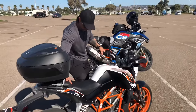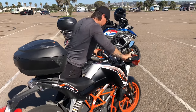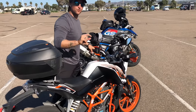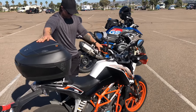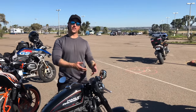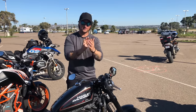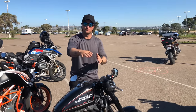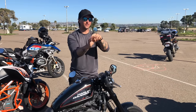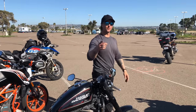Now the KTM — I push down at the angle of the forks. It comes up and then sinks way more than it should — non-adjustable forks. Some people ask if they can just pour thicker oil in. Now you've got syrup flowing through — it might feel tighter initially, but if you hit a sharp bump you'll get hydraulic lock, where you can't push enough oil through the hole and everything stops. Highly recommend reading Total Control, and going to someone who actually knows what they're doing.